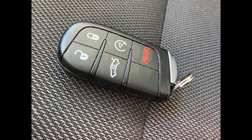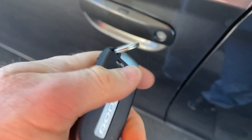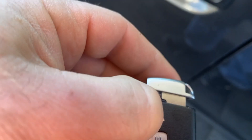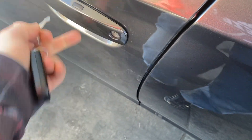How to start your vehicle with a dead key fob battery. If you get to your vehicle and you can't get it to unlock, there is a key. You're just going to pull this to the side and then slide this silver tab up. You'll slide that over and pull the key out, put it in, and you can unlock the door.